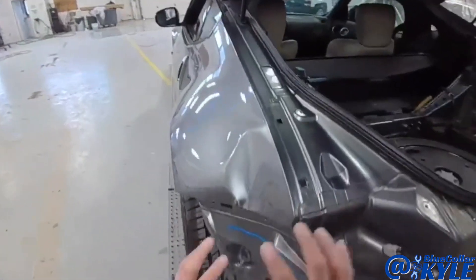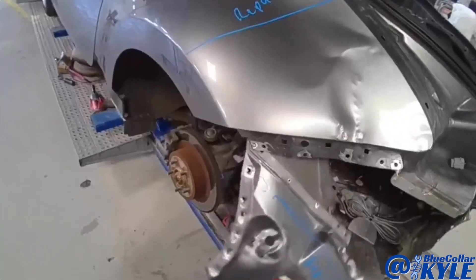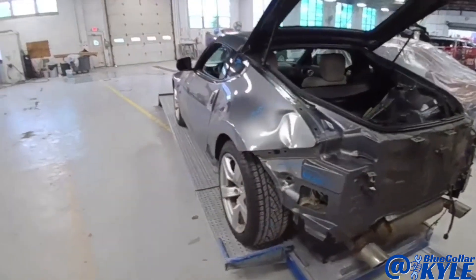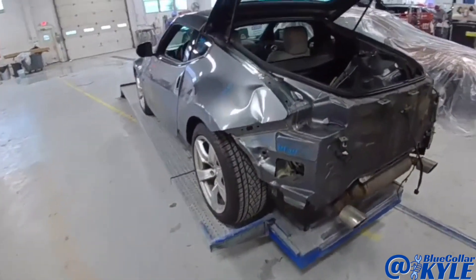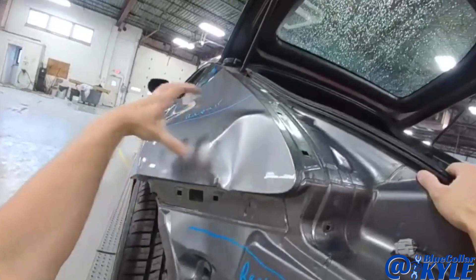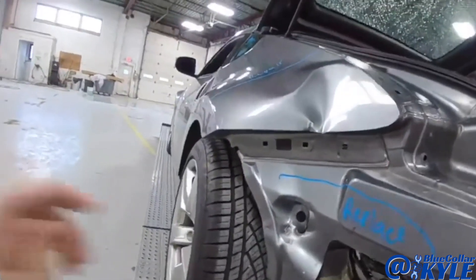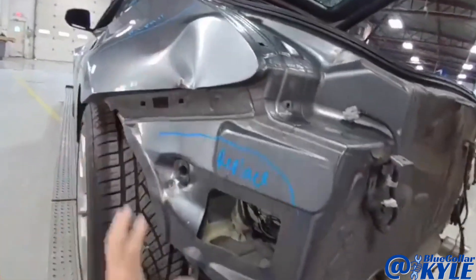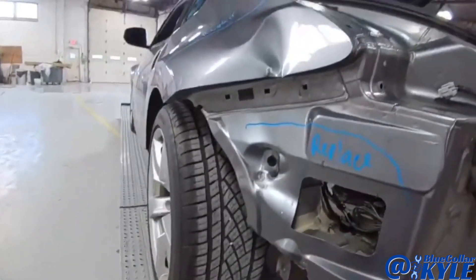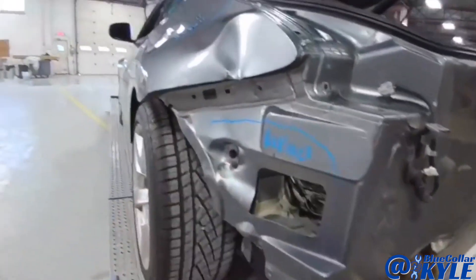I'm gonna put one more thin coat over this thing. I had a Nissan 370Z here — this one got hit in this corner just right and it caught right here and wadded up this quarter panel real good, tore some holes in this quarter extension down here. So this one I'm gonna repair the quarter panel and I'm going to replace this bottom extension piece. I'm still waiting for this new piece to come in but I'm gonna go ahead and start on this, working this quarter panel out, and then I will get this piece cut off and out of my way.